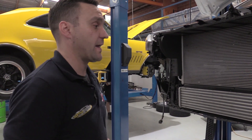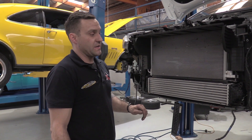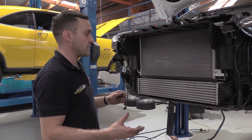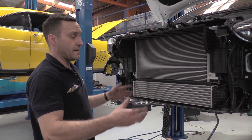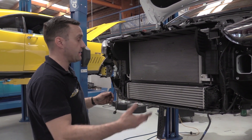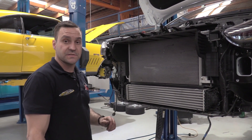The next part of modifying our i30N is upgrading the standard intercooler. We'll be fitting the new Forge Motorsport intercooler, which is obviously a lot bigger in surface area with a much larger core and also includes a larger diameter hot pipe. I'll be porting both sides of it so we can measure any pressure differential drop for our own data, and also monitoring the air temp once it's back on the dyno to see what improvements it gives us.